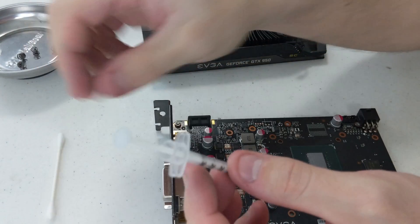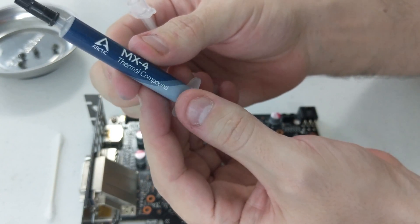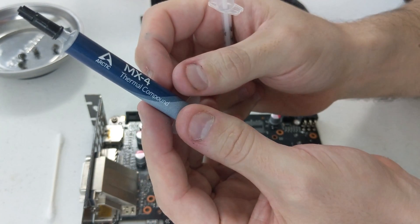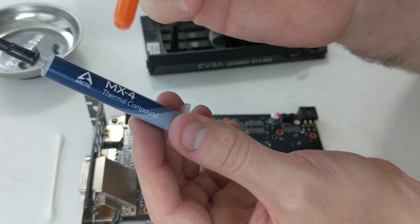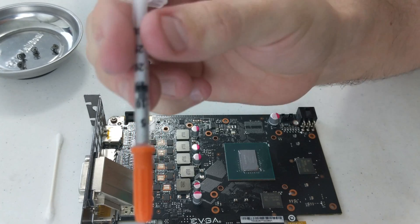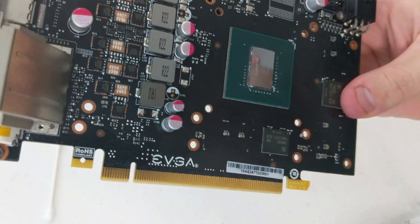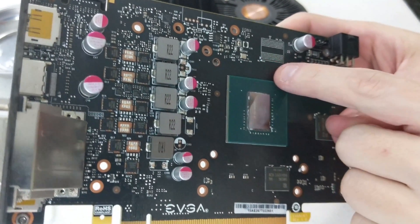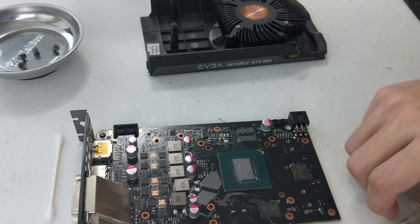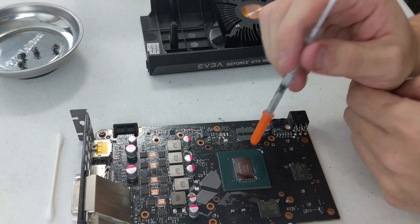You might have been wondering what the Q-tips were for. This stuff is not like thermal grease at all. Thermal grease — like this Arctic MX-4 compound — is non-electrically conductive grease material that is good at conducting heat from metal-to-metal surfaces. What this is is a metal-based — I think it's made from gallium — thermally conductive and electrically conductive material. The electrically conductive part is the problem. When you put it on a GPU or CPU die directly, if you get it anywhere off the die itself, you have the possibility of creating shorts and burning the entire chip. So you have to be very careful — use it extremely conservatively. Just the barest of dots. A dollop will do it.